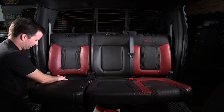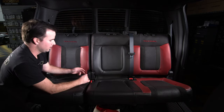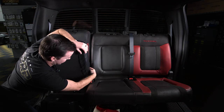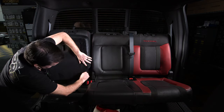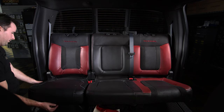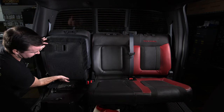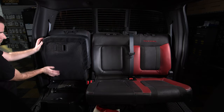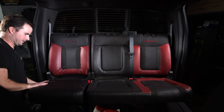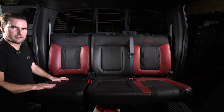Going to the front, everything's looking pretty good. You'll have a couple of little elastic bands — pop up the seat belt, feed them down around that corner, and attach. There's another flap in the corner that you want to tuck almost underneath that plastic piece and around it, so it gets a good angle, then attach to the carpet. Do your final check — work your hands around, make sure the cover is fitting nice and tight without major wrinkles. If needed, undo the hook and loop strips underneath and retighten.